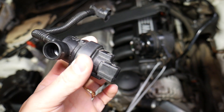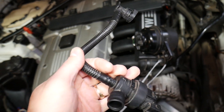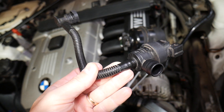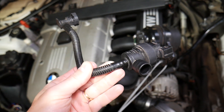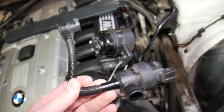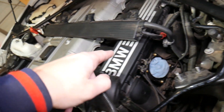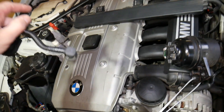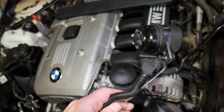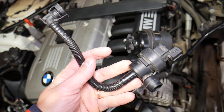When you have gasoline in your fuel tank, it expands and creates fumes and vapors. Back in the day, those were released into the atmosphere, but now because of emissions regulations and to make your engine more efficient, they developed the EVAP system. This purge valve takes the fumes and vapors from the fuel tank and injects them into the intake manifold, where they burn through the engine and exit through the exhaust. That way the car is more efficient, uses less fuel, and doesn't pollute.